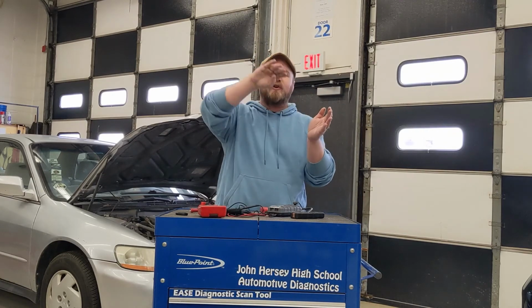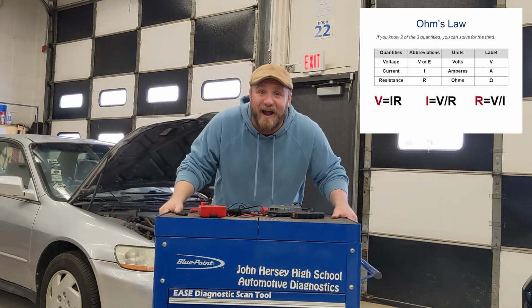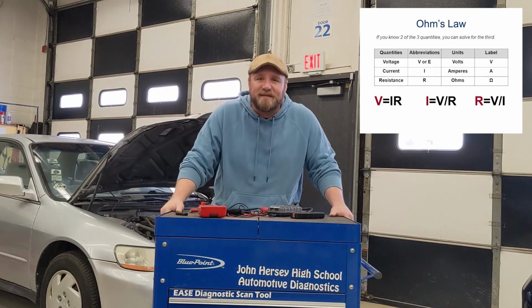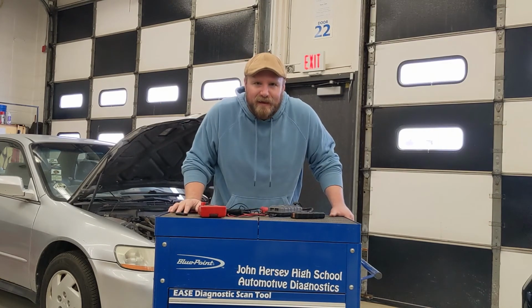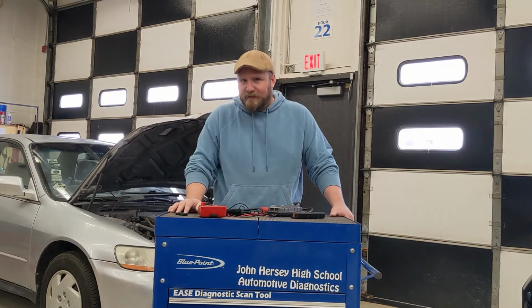In the next video, we're going to take a look at measuring cold cranking amperage from a battery using a Snap-on battery tester and also a digital oscilloscope so we can plot over time what happens to voltage as current increases. And we can start talking about that Ohm's law, V equals I times R nonsense that you learned about in physics and thought, when am I ever going to have to use that? The answer is every time you start a car, you're using V equals I times R.